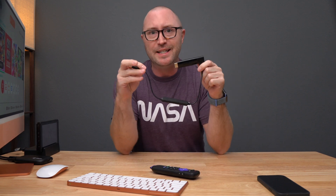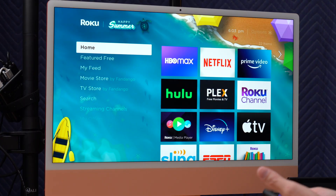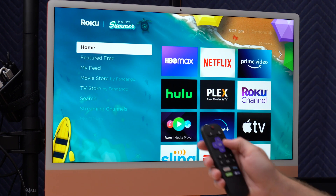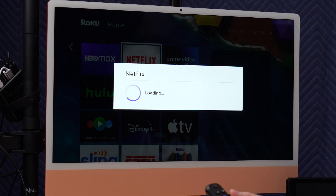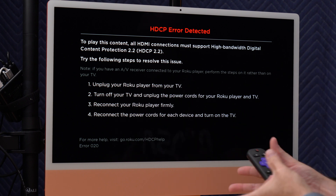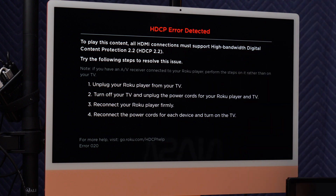You might be wondering how far you can push it — can you connect something like a Roku or a Fire Stick or an HD Blu-ray player to the iMac? And the answer is yes, you can connect pretty much anything with HDMI through the HD60S Plus into the iMac. However, you are probably going to run into some issues with HDCP. Whether that's a Roku, Apple TV, Amazon Fire Stick, Blu-ray player, or some other thing that uses HDCP and enforces it, you're going to run into issues and you won't be able to play that protected content.